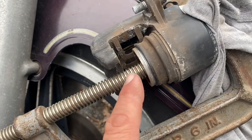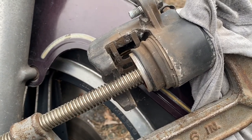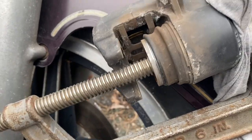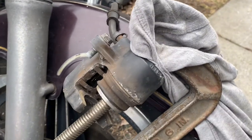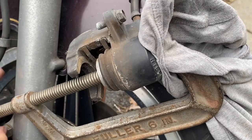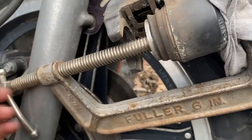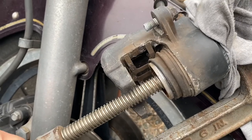I plan to put a wood block in here to keep this from coming out when I pump the fluid out, because I don't want to ship them with brake fluid in it. As I turn this, we're pushing the fluid back out of here and up the line. Just want to do it steady — it's not pushing hard, so that tells me it's not seized up and it's still pretty clean and working well. You can see the dust boot dropping back with it, and there's a little ring that holds the dust boot on.